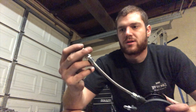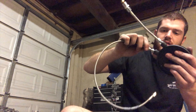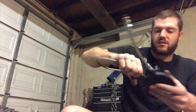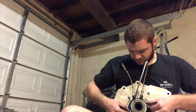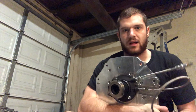The external bleeder is on and you can basically bleed it with this knob right here. After that I'm just going to tighten on my Dash-3 line so I can have it there and not have to worry about taking this apart later. Slave cylinder is ready. I'm going to take my adapter plate and bolt it down — so it is on. The next step is to bolt this onto the bell housing.